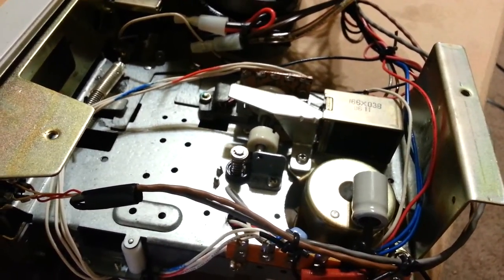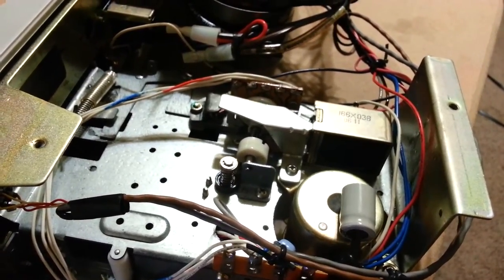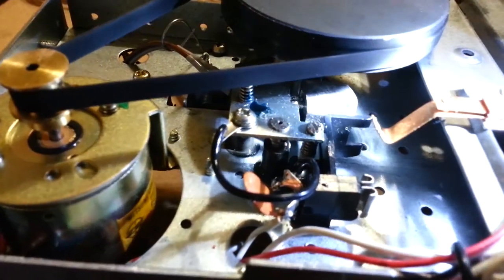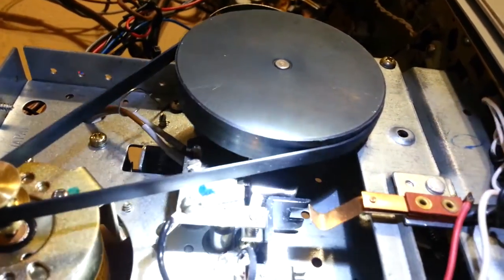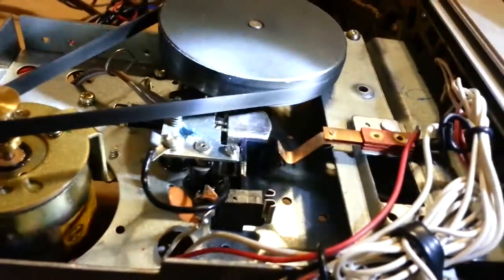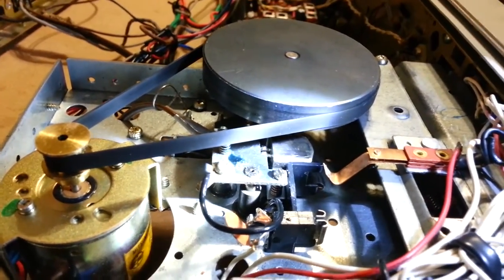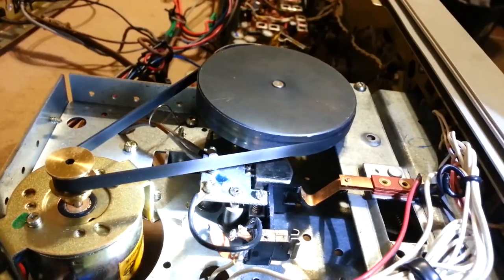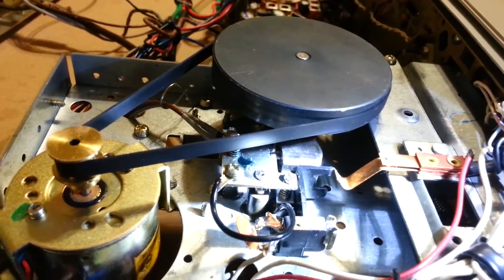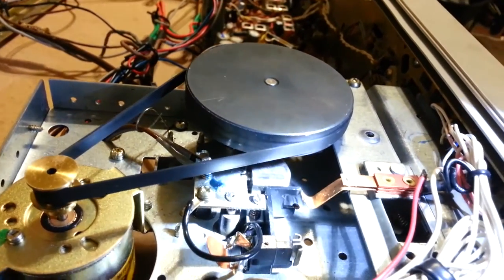The other thing was, I noticed it had a really warbling, kind of muffled sound when I played the 8-track, and I found a couple of screws that can help you adjust that if you have a similar styled 8-track player. Right here we have the head of the player, and in here you can see some screws. Two of them will actually help you fine-tune your tracking for your 8-track tape. If it's playing and it sounds like you're getting some bleed over from another track, or it sounds muffled, try very gently adjusting those two screws and eventually you'll get it. One screw adjusts the tilt of the head, and the other adjusts the height of the head. Between those two you can get a good balance, and I seem to have accomplished that.